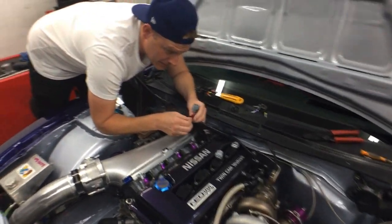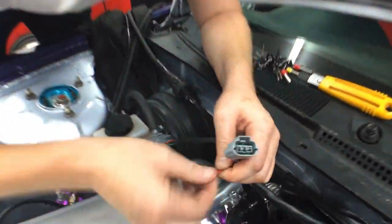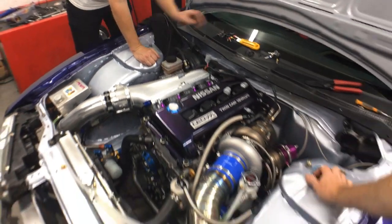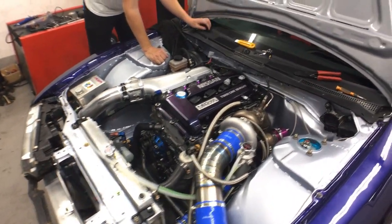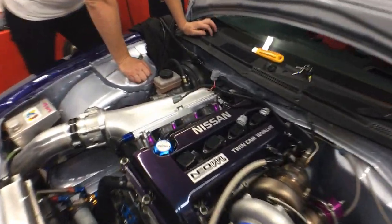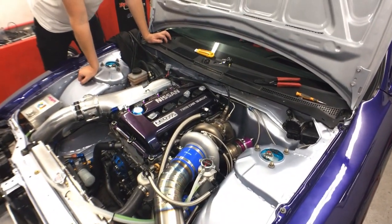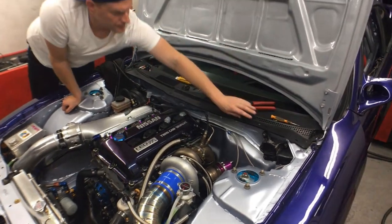What are we doing, Rob? Fixing up a bad wiring job on one of my coil packs. We had a slight miss — we were chasing it and found that we were missing one of the resistors out of the R35 GTR coil pack, and then when unplugging it we accidentally ripped the plug off.